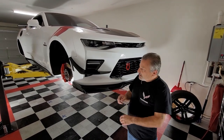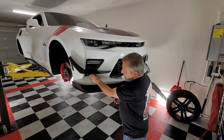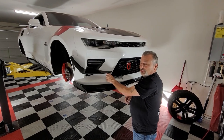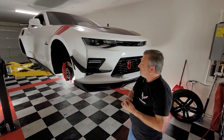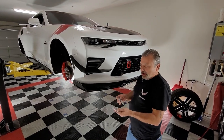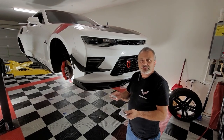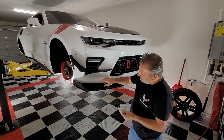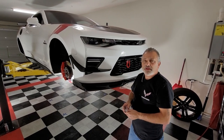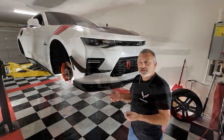At that point you'll have access to your holes that we're going to be able to drill into the bumper, and that's pretty much all there is to it. The kit comes with the rivets that you're going to need — they're 7/32nds rivets. So we're just going to drill the holes and run it through a rivet gun, and it's pretty much done. It's a very simple installation.